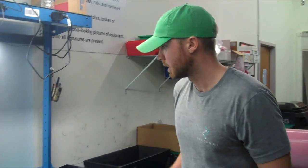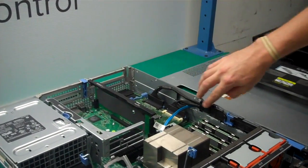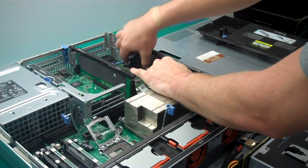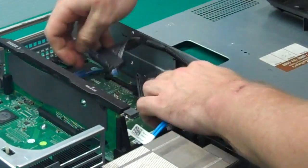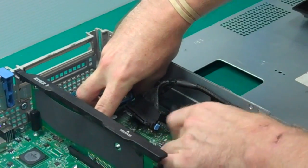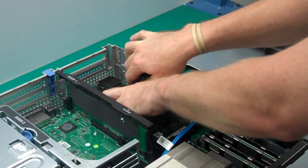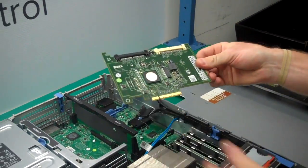Next, we're going to take out the cache card. This is a little bit more difficult because it has a few more pieces to it. As you can see, it has these two cables that go to the back plane, so we're just going to disconnect these two cables and get them out of the way. As you can see, it's still connected to the riser card, so you want to go ahead and pop that out, being as gentle as possible. Once it's out, push back and go ahead and grab it out.